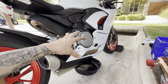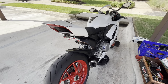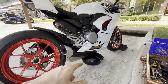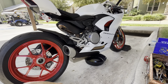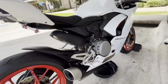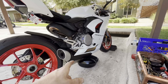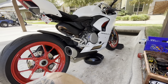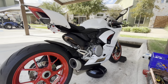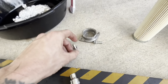Don't forget to double check your oil after the bike has been running. Also make sure you tighten that bottom drain bolt — I've seen guys forget. Don't double up your crush washers on the drain plug either, because it will leak. Don't put two washers on — I've seen guys make that mistake because they didn't physically go down and check whether the old one was still there. Replace the crush washer, it comes with a new one for a reason. After running the bike for 20-30 minutes, check the oil again because it'll be lower once the filter soaks it up. By the way, these filter cap bolts are 8 millimeters.